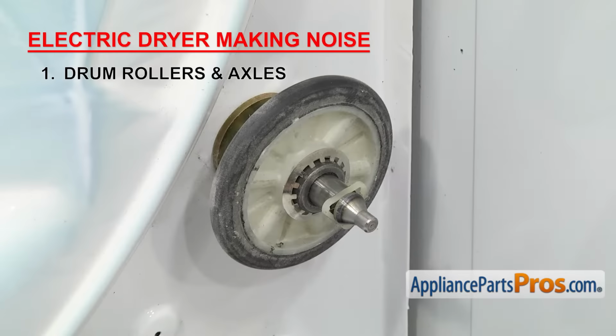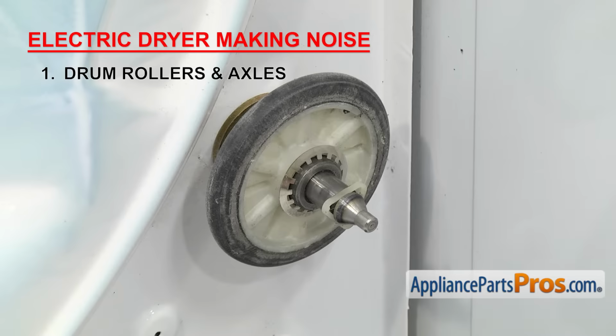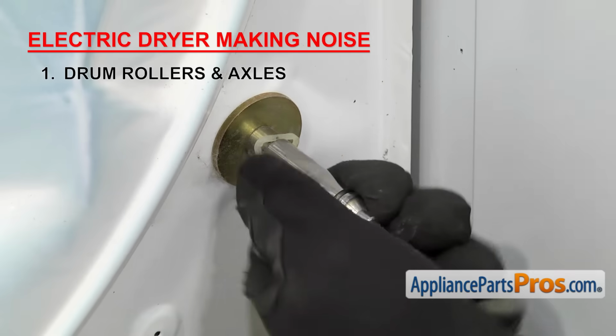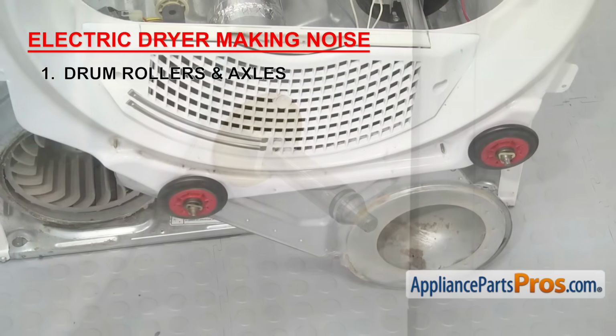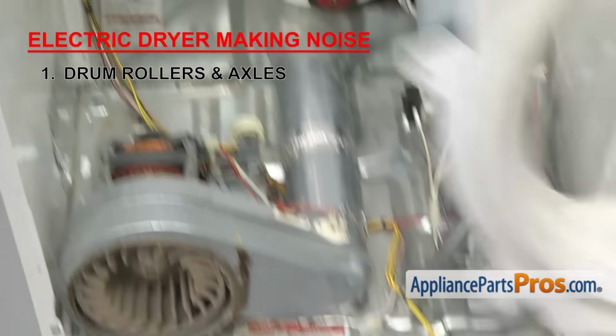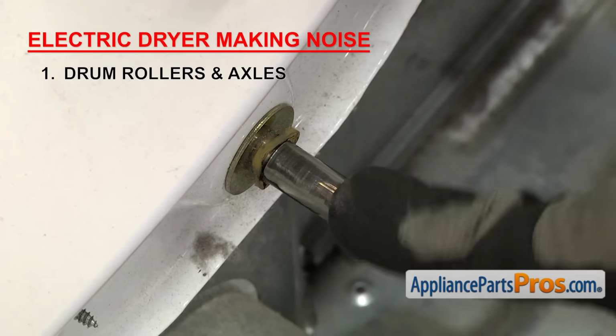When inspecting the rollers and axles, you want to make sure that the rollers spin freely on the axles. If the bearings have failed and you caught it soon enough, the axles may still be okay and you can just replace the rollers. If you need to replace any of the rollers, it's best to replace them all as a set. If any of the axles are scratched up, you can replace them as needed.